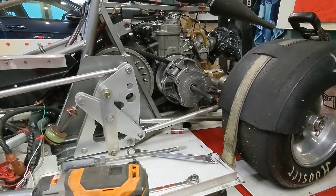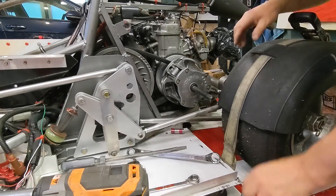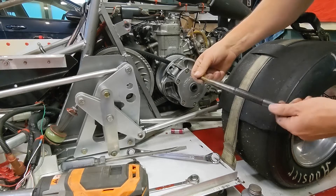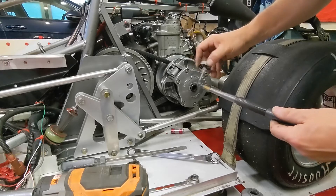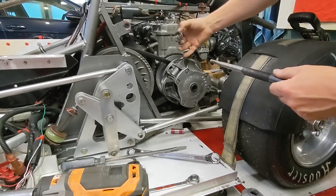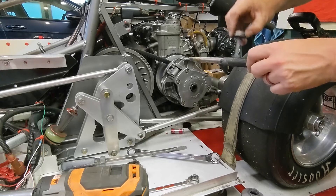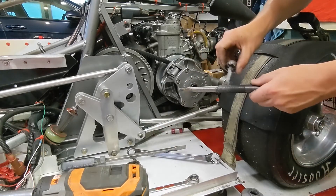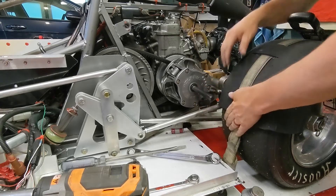This just threads in. What I actually like to do on my clutch removal tool — because what happens is you're driving this in like a bolt and it's going to push against the engine and pull the primary off — is put maybe a little bit of grease. In this case I'll just use some NACs, put it on the tip of that thing, because it basically has to push against a hard surface, the snout of the engine. So I want to give it just a little bit of lubrication, and then a little bit on the threads as well.